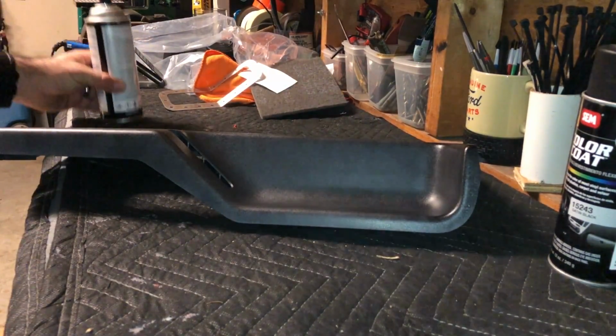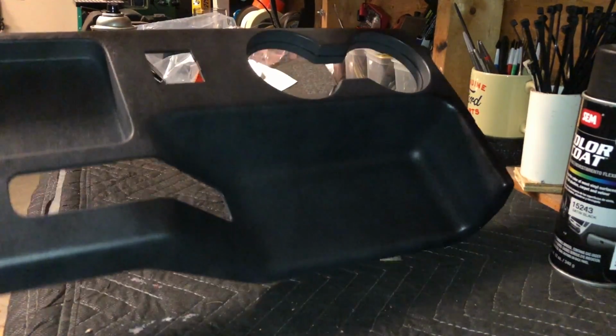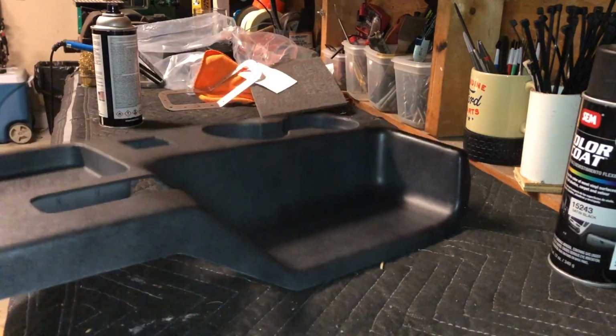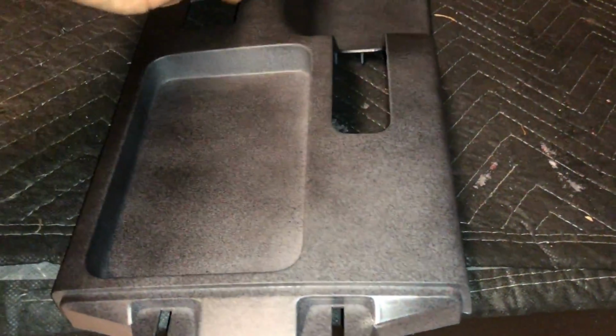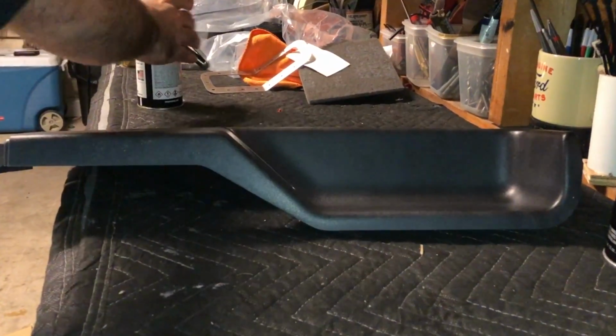Okay, let your second coat dry, and as you can see, it starts to cover really quick. So honestly, what I recommend to do first is go ahead and get into all of your corners, everywhere that you can first, because that's typically the spots where paint's gonna try to puddle up on you, or you're gonna get a run or something like that. So before you really start to put a lot of paint on this thing, go ahead and hit your corners and inside of everything like this. All right, we're gonna go ahead with the next coat.